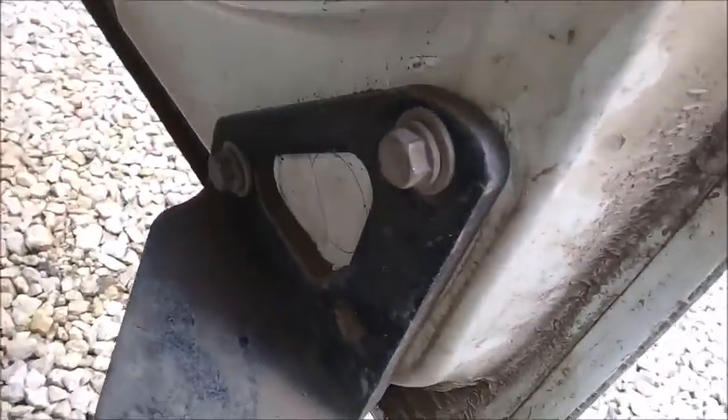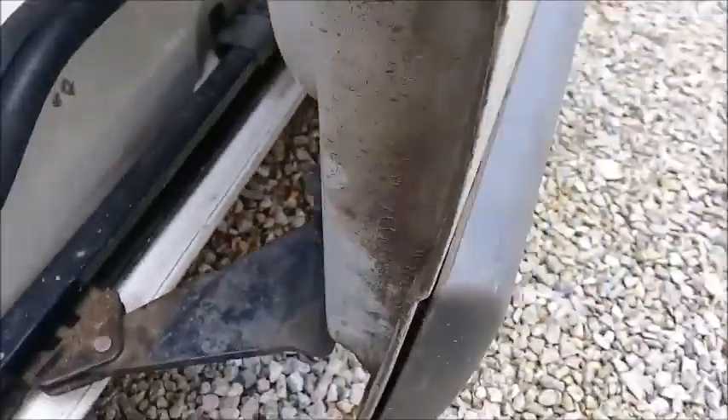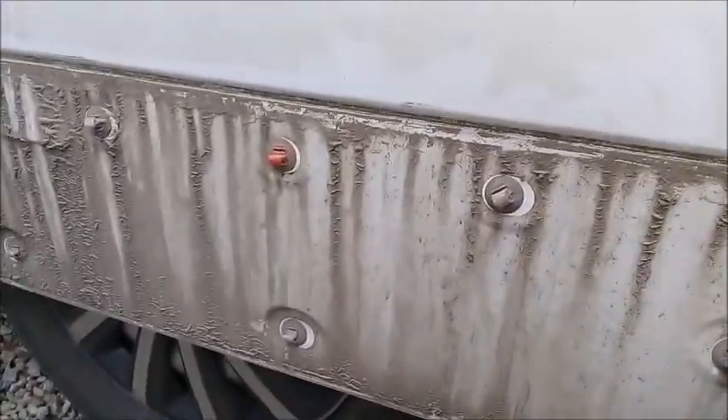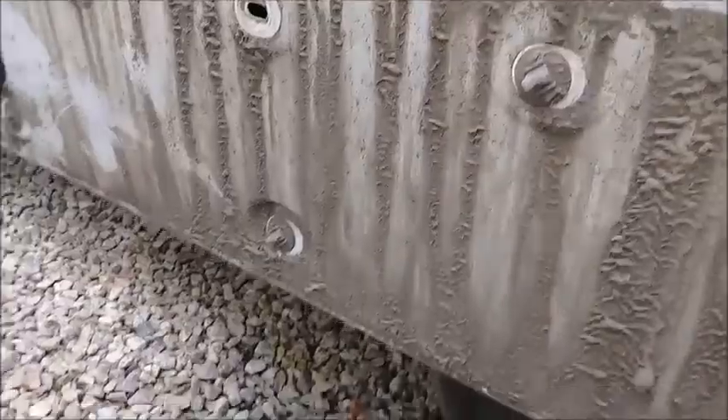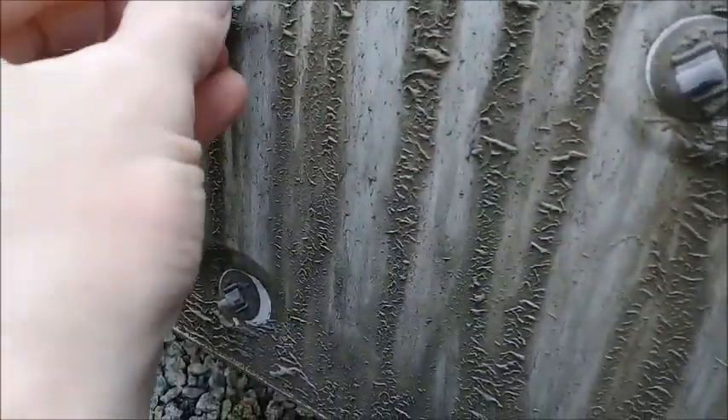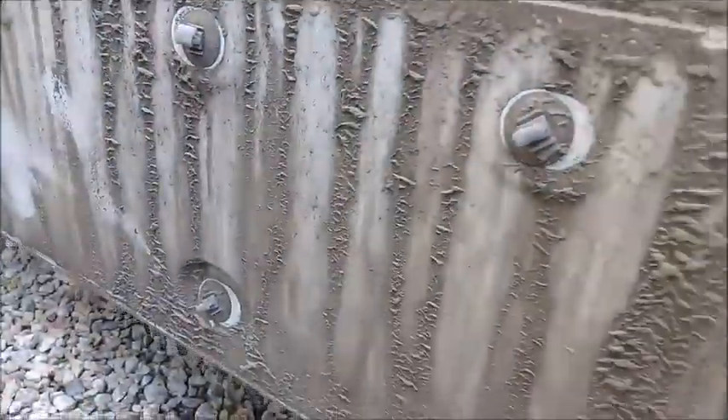This bracket can also be used for aligning the door, so undo those two bolts and you'll also need to take the trim off on the outside. This trim had been taken off before so when I hit it, it just flew off, which isn't usually the case. The trim comes off fairly easily — it's got poppet guides. They're like little push fittings with guides that lock into the trim, so you just pop them back and align them horizontally.